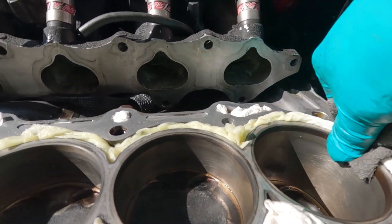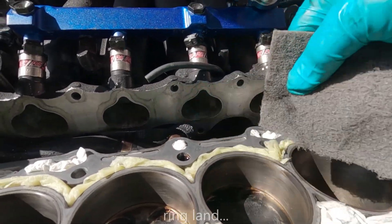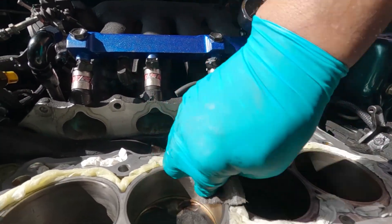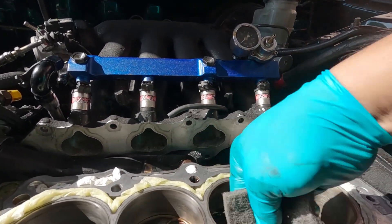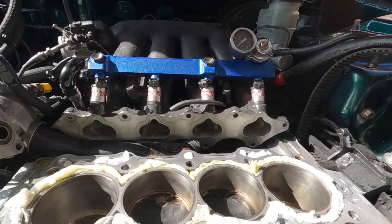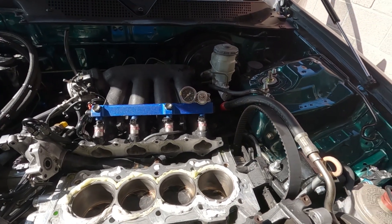That one's good. Because if you have a heavy concentration of carbon deposits, that can break your ring grooves when you remove the piston. And if your intention is to reuse that piston, there's a possibility of breaking it when you remove it. Just use a scotch brite — that should do it. Blow some air through those to clean it off, then spray some WD-40 on it so it won't corrode.